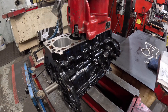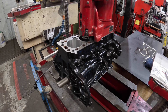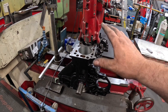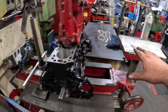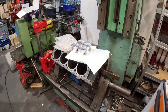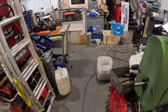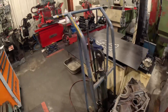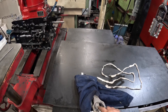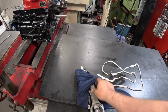So this is a red top Vauxhall and this is for a silhouette that races on the same kind of tracks as what the pickups race, normally at the same time. I'm boring this out to the first oversize for my customer. I've got to gap the rings and then I'm going to keep everything in cylinder order. So I've been and weighed the pistons and measured all the pistons as well, so we know exactly where we are with that. His con rods I'm actually just sorting out as the boring bar goes down each one, so I'm just balancing them. They're nice rods - they're Arrow rods, quite old but they're still nice.